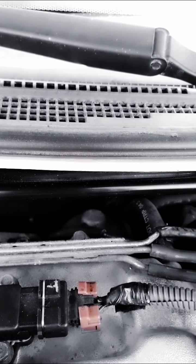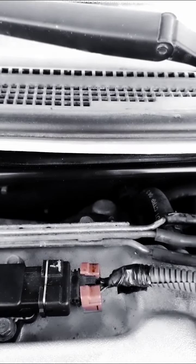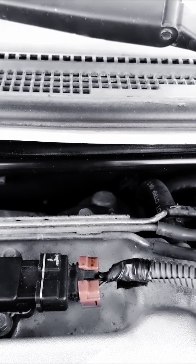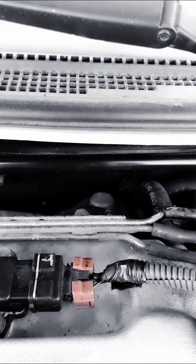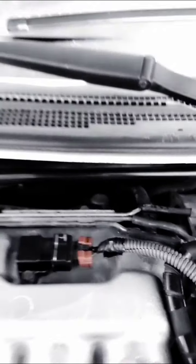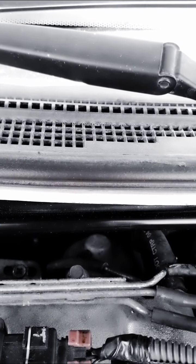The gasket costs about a dollar at AutoZone - that's the cheap way to fix the P0401 code. After you finish cleaning it out, don't put it back on quite yet. Get some WD-40 or lubricant and spray it inside the EGR valve ports so everything moves smoothly. Let it soak in there for about a half an hour, then pour out all that lube and let it drain and sit for a while.